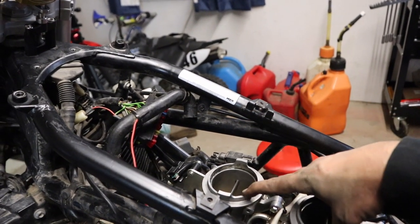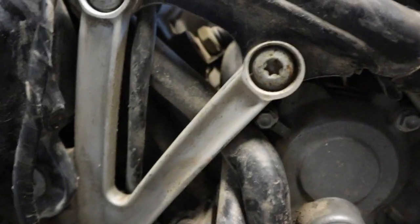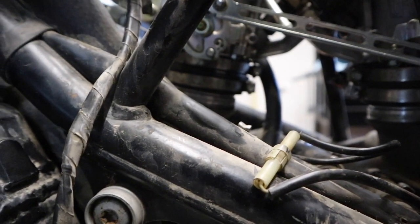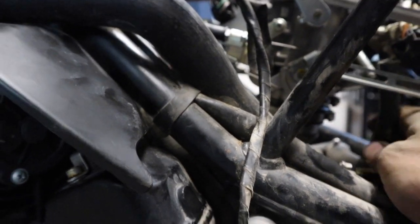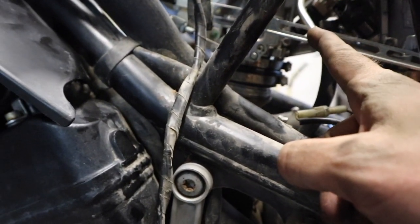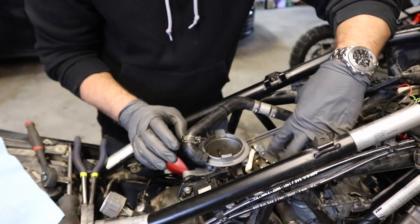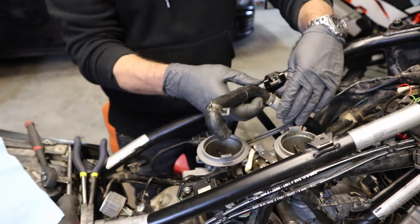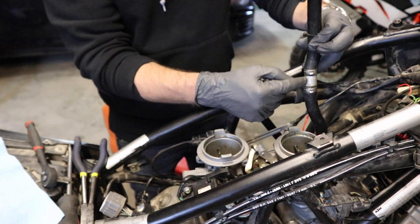Now I'm back to working on this new airbox. All you do is just press your throttle bodies back down and tighten up your bottom hose clamps. It's going to look like they're up off there a little bit — it's not going to look perfect, but that's okay; that's just the way they're machined. Next, grab our hose clamp and get our fuel line hooked back up. With the throttle bodies reattached and fuel line on, next we need to get this check valve out. These are permanent hose clamps so we'll undo these with a screwdriver and pull out the check valve.